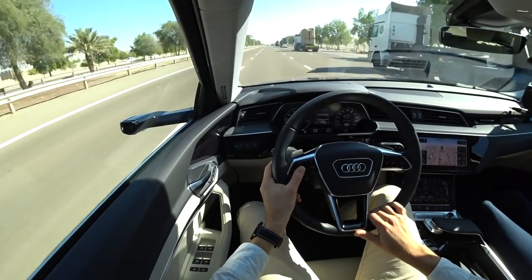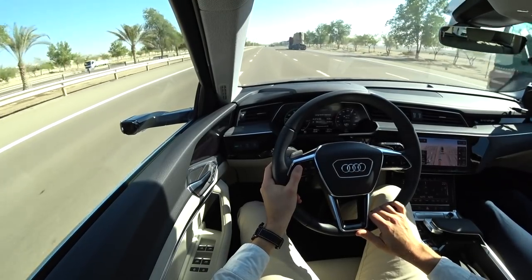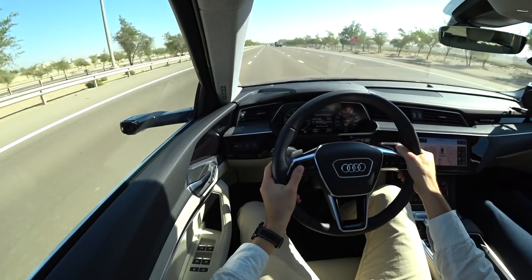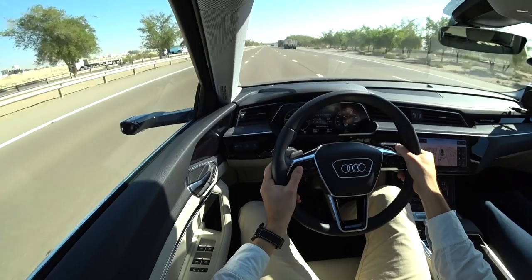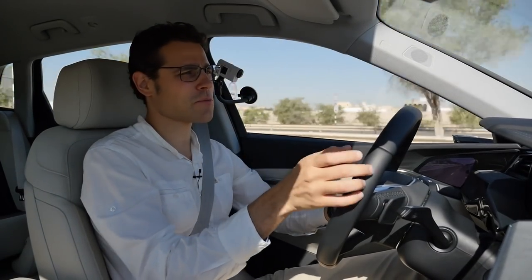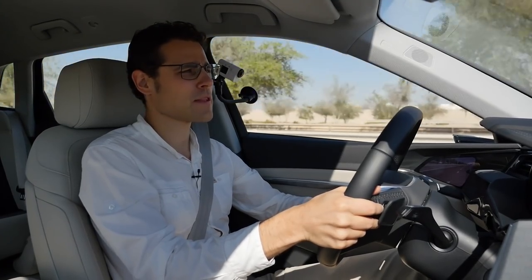So now at 27.4, so a little bit definitely, and the overall is again 27 overall at the moment for the trip so far. And if we then calculate it, if it's a 95 kilowatt hour battery and it's about 27 kilowatt hour consumption per 100 kilometers, that's of course not 400. An easy calculation would be, say, 25 kilowatt hours per 100 kilometers and a 100 kilowatt hour battery, like with the Tesla, that's 400 kilometers of range.